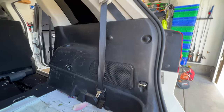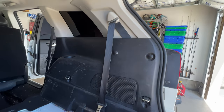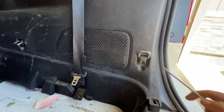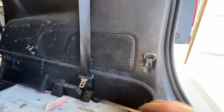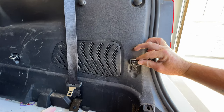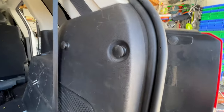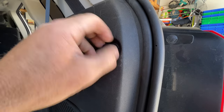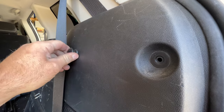So it looks like I'm going to try to pull this panel off without having to remove these two top ones. Looks like right here at these little hold-down clips, you can get under it with a flathead screwdriver — that kind of pops that open. And then there's a Phillips screw in there, so I'll do that to both of these. And then looks like for this cargo net, I think you can just turn this one and unscrew it. And then towards the front of the panel here, take your screwdriver — looks like you got a little one right here, pop this off. And then we got a Phillips screw right there as well.